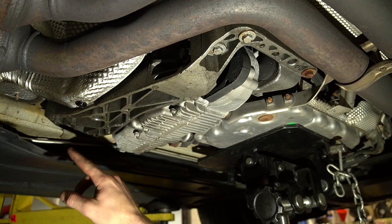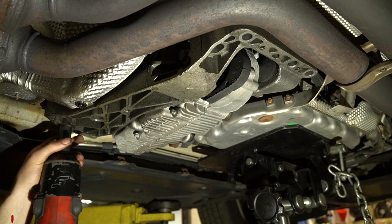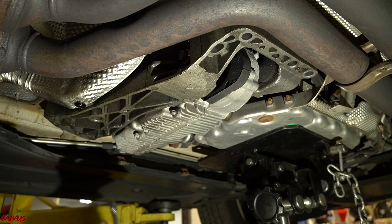We're going to remove six 13mm bolts from the crossmember — one long, one long, one long, and three short ones. The torque spec on those is 19 Newton-meters. Then we remove an 8mm bolt for the heat shield, and there's another one behind the curve of the exhaust.